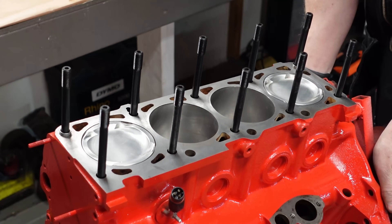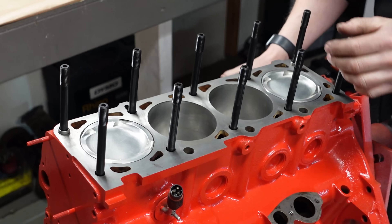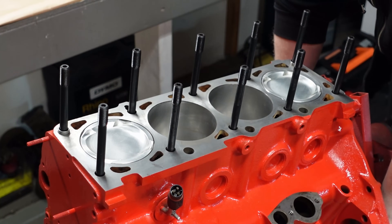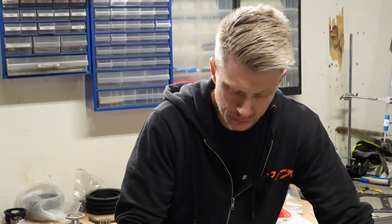I've chosen to go with a slightly smaller bore dimension on this build. Usually we use 96.5mm pistons, but in this case we have 96.25mm pistons, because the cylinder block is not the happiest about these power levels. This has been a fast walkthrough of this 800 horsepower build. If you have questions, write them in the comments. Take care, subscribe to my channel — I need to put out more English content because I have a big English audience. Bye bye.